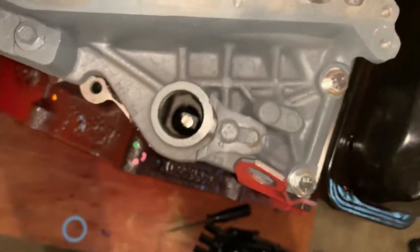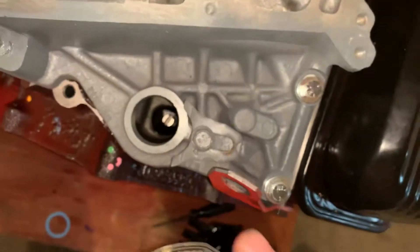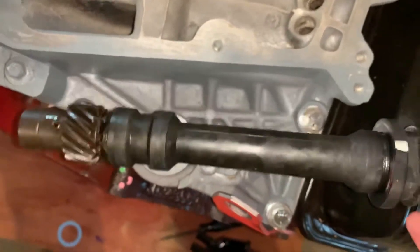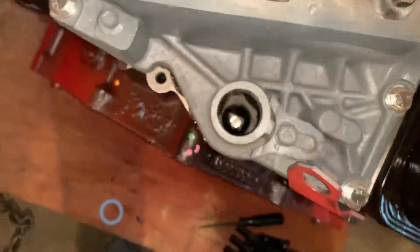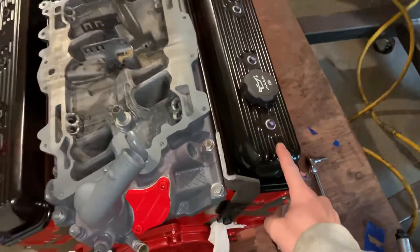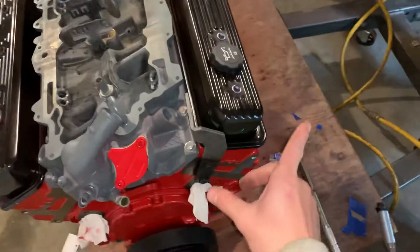The first thing to do is you need to get the camshaft in the correct location so it can mesh with this. Because this is mechanically meshed, you can't adjust this — you just have to set the timing correctly. How you do that is you set your engine to top dead center. When people refer to top dead center, you're always talking about cylinder number one. In this case, cylinder number one is all the way towards the radiator and on the driver's side.